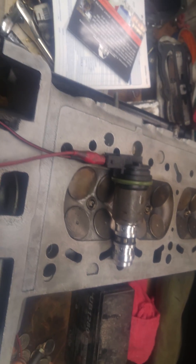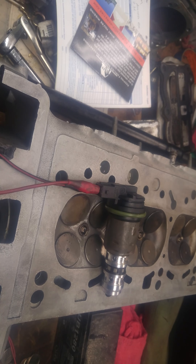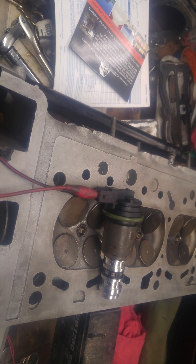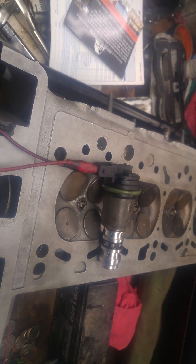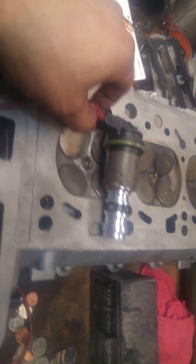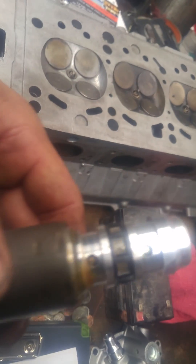It clicking doesn't necessarily mean it's not bypassing with oil pressure or that pressure isn't leaking off. This just tells us that the cylinder inside is actually moving, so at least we know the electronics portion is working. It could still be leaking internally and causing an oil pressure problem, but at least electronically you know it's good. You could also do resistance measurements.